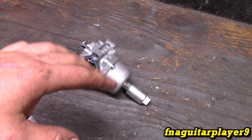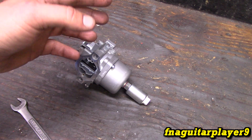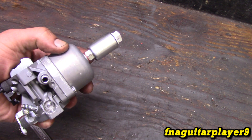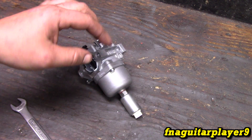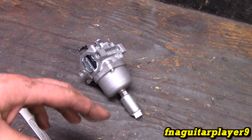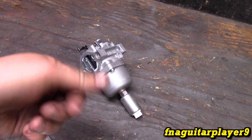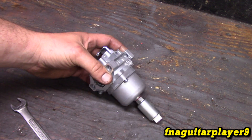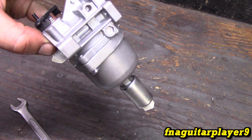It's not a fuel injector — it acts similar to one but it's not. And it's not an electronic float or needle valve either. All these do is prevent the motor from backfiring when you shut it off and save you just a few drops of fuel when it coasts. That's the only purpose of these. They are making fuel-injected lawnmower engines now, and I've seen them on generators too, but I haven't messed with them yet.